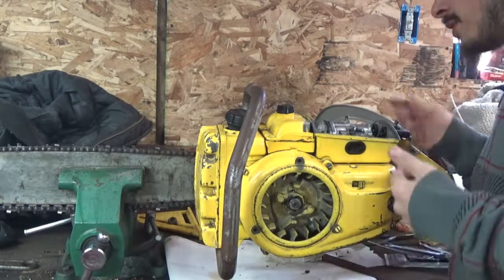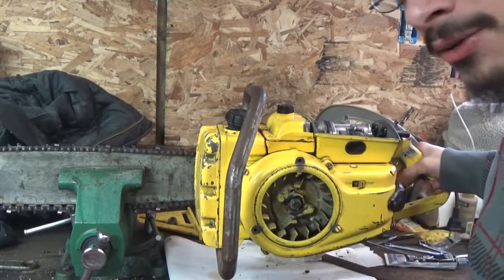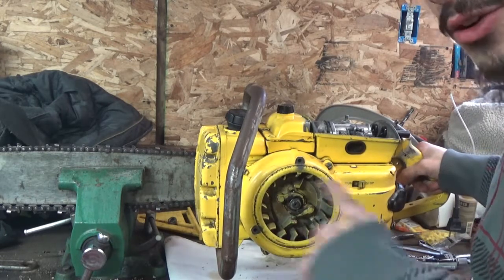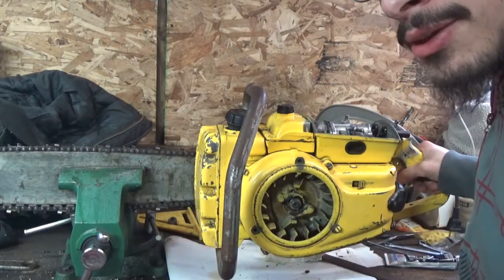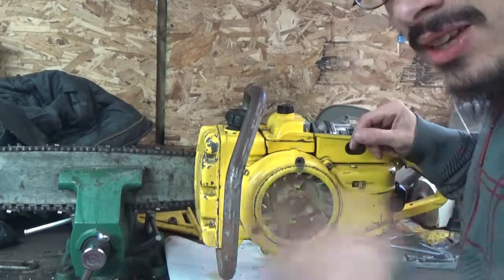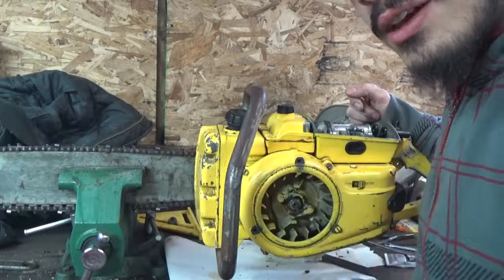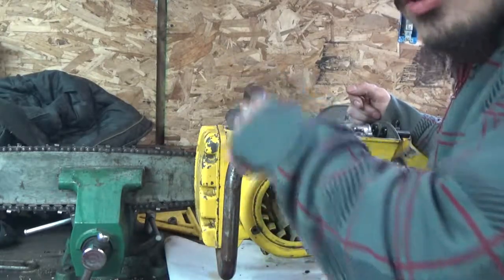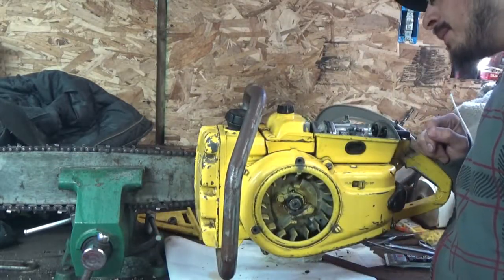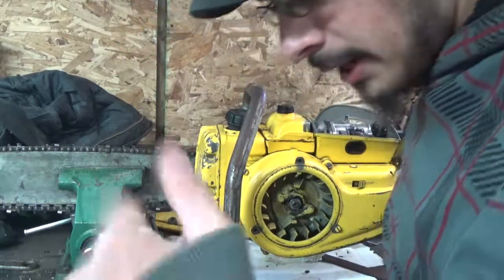Well, from what I can see, everything's... I might know what the problem is, guys. Internal in the engine. Let me go back to this footage and see if I have it, then I'll give you an idea of what's going on. You might be dealing with the float inside this carb. Just give me a minute, because I believe it was hooked up correctly. If it's not working correctly, that's why it's not shutting the fuel off to the carb, and that's why it keeps dumping gas back out of the carb. That may make sense now. It's not leaking now since I ran it pretty much out of fuel. So let me go back to the old footage and check.